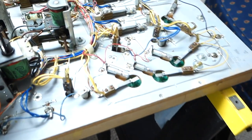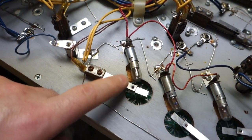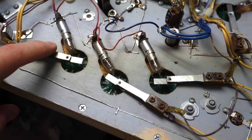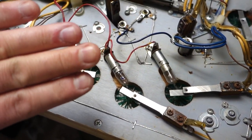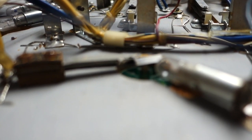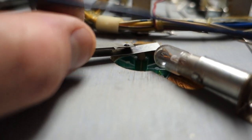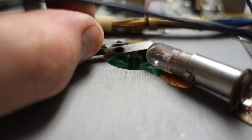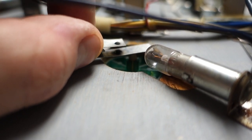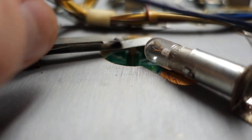Anyways, going to the bottom of the playfield, I have to go through every single one of these switches and adjust them. Some are just twisted on an angle instead of being straight, like here's one that's twisted. If you can see it once it focuses in. Instead of being flat, you can see how it's twisted. It's got to be straight instead of riding on an angle. I got to fix that.